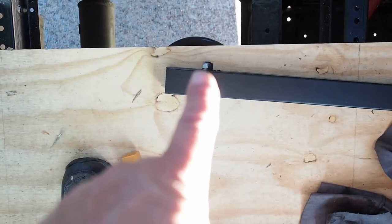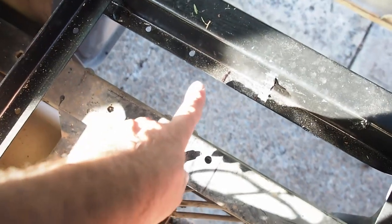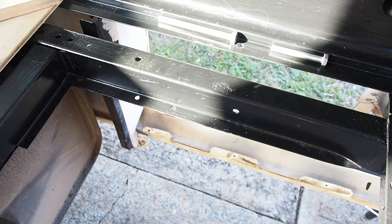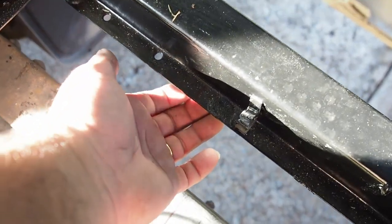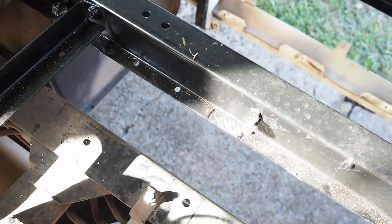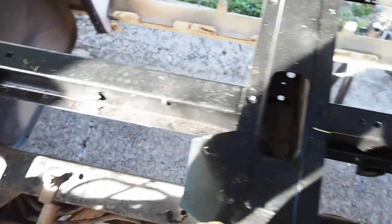Good morning all. I've done all the bracketing, painted it all, measured the threaded rod and cut that, so it's all ready to go. The problem I've got now is I've just got to make sure that where I've put the threaded rod and the nut on top fits under the little railings along the chassis. These nuts on top of the bracketing have got to fit under here on either side — some sides are okay but others are knocking, so I've got to cut away this section here so the nut can fit in and allow the bracket to sit under there. I've got to do at least four of them.